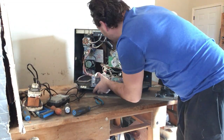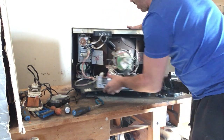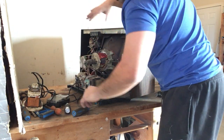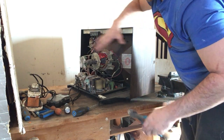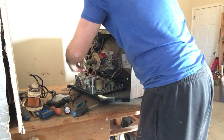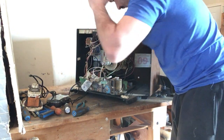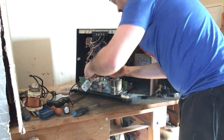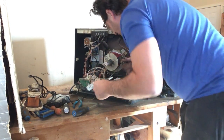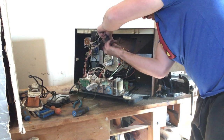This one I'm not going to take fully apart, but you do have some circuit boards here with some MLCCs. This copper is your red color — if I scratch that, it's going to reveal a copper color underneath. But rule of thumb, I do have to cut this red cable so there is no more magnetic charge. Then I pull this off. Sometimes you can just unscrew the yoke clamp — there's the bolt, and there's always some glue, so all I'm doing is turning it just to release it.